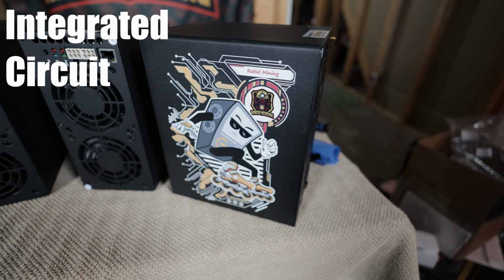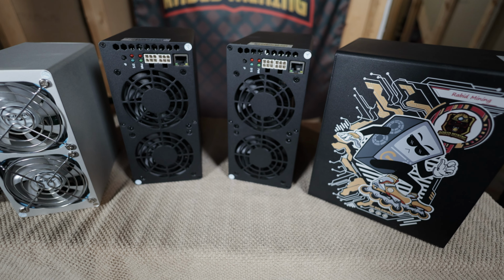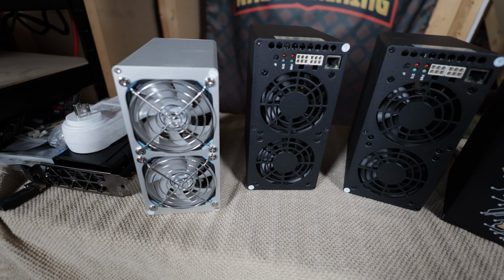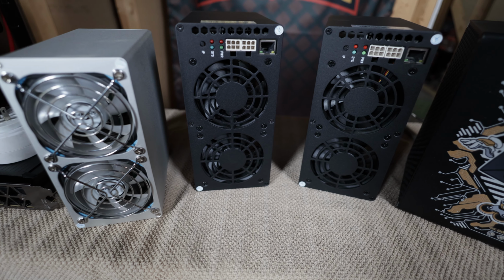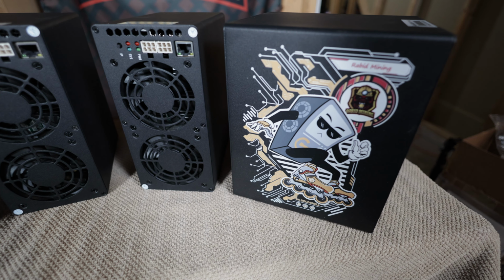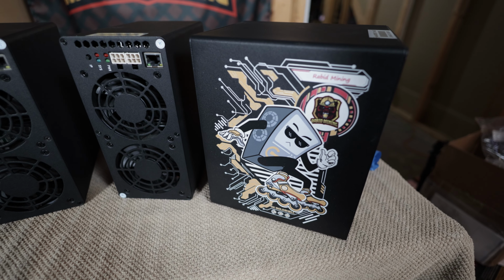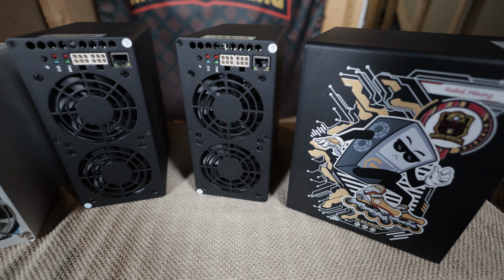What that pretty much means is it is a miner designed for only one type of algorithm, unlike GPUs and CPUs that can mine multiple different algorithms. ASICs are designed just for the one single algorithm, and you cannot move them to any other algorithms. But for the algorithms they are designed for, they are the most efficient hardware for that coin. And Dogecoin runs on the Scrypt algorithm, which is ASIC dominated.